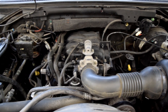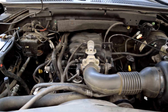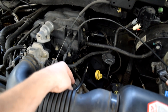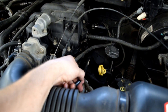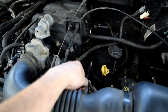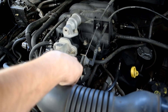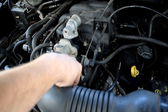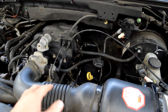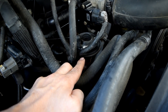Something I should have mentioned is that before you go tearing into this intake manifold, you want to cover your bases and make sure you check your PCV valve. Make sure you block this hose — I can't really pinch it because this is a plastic, not a rubber hose. The next best thing would be to remove it from this end and block both sides and see whether your fuel trims start improving. If they do, you have a PCV valve that's stuck open at idle. Same thing with an EGR valve.